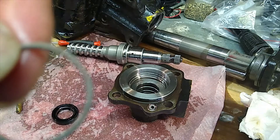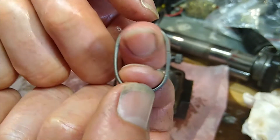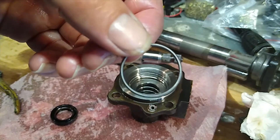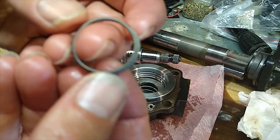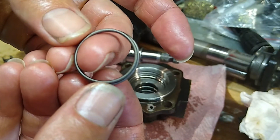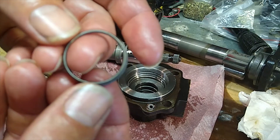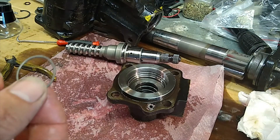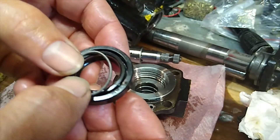I'm just going to have a close look at that under the little monocle to make sure I haven't got any sharp or hairy bits. I'm happy with that. If we compare it to the original spring size — the original is the one behind and the new one is in front — you can see it's a slightly smaller diameter, which will give me more compression on the seal on the shaft when I reassemble it.